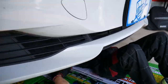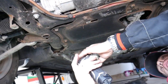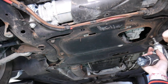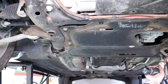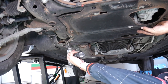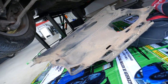Once we remove the engine splash shield and transmission splash shield, we can get to the engine shield guard pan. That's a 13mm socket — we pre-loosened some of the bolts to save you time. You can see where the bolts are located. That's a very handy impact driver — I'll put the link in the description below where we got it from, it makes your life so much easier. And that's the engine pan shield guard, came out just like that.